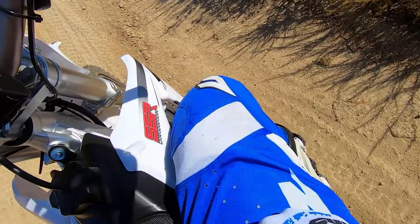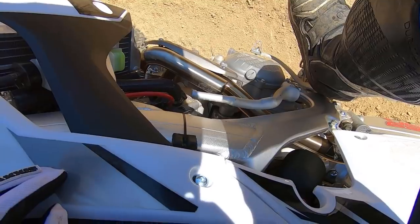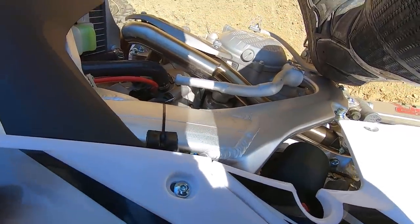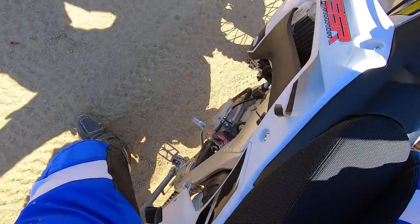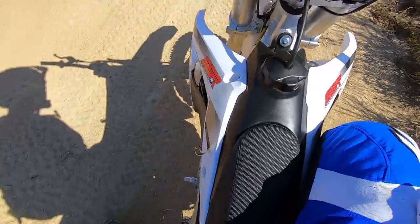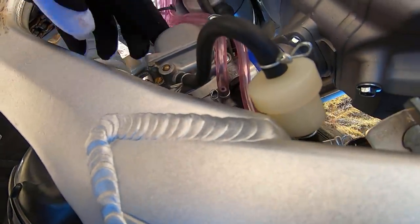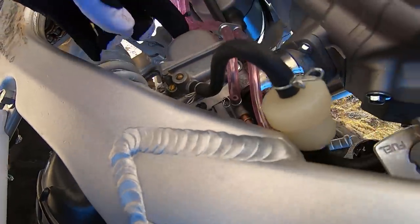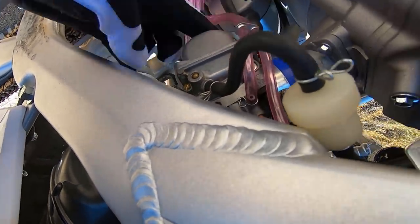Anyways, pretty dang cool. The carburetor is holding this bike back. Definitely. It's too lean, the engine's getting hot, it's running not bad, but worse. It's just choked up. If we can get a little more fuel into the engine, it'll help cool the engine, and man, maybe I'll swap some jets at the truck. Super easy to get to this carb. Give it a little spin, pull the 17 millimeter plug off the bottom, swap another pilot and a main, and let's have some fun, you know?